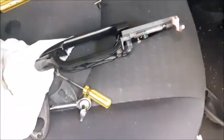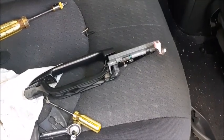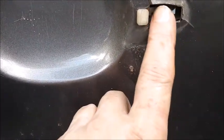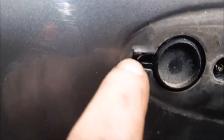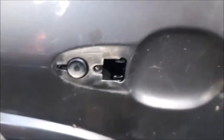I'll put it back together and we'll try it on the car — didn't have to replace anything. When putting it back from this side, make sure this piece slides inside so it locks in, then screw it from this side. Over here there are just two little pins that squeeze down — put it in, then go back on the other side. After installing everything, put back the rod inside and slide the little pin over to lock it.